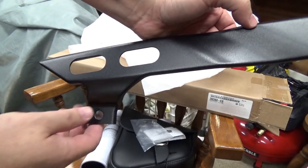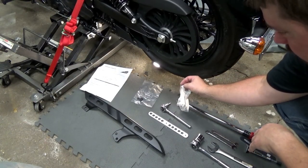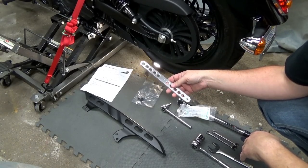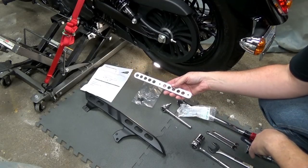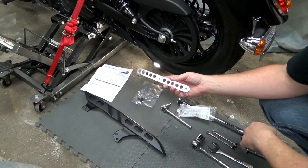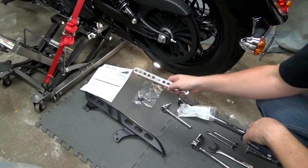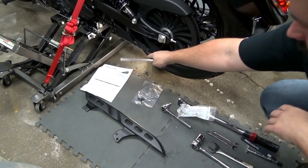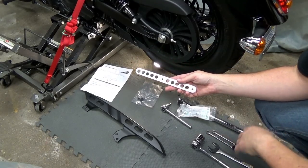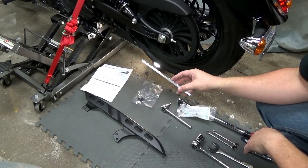A collection of all the tools I'm going to need, and I've got some hardware I bought. I made this up — it's just a piece of bar stock aluminum, and I drilled all these holes and chamfered them. This is the hole that the tie wrap is going to go through to help hold the front lower corner of the swing arm bag. I'm going to mount this to the lower mounting holes on the lower belt guard, and with this extending outward, I don't ever have to worry about whether that leather bag is going to touch that belt and possibly get sucked into it.